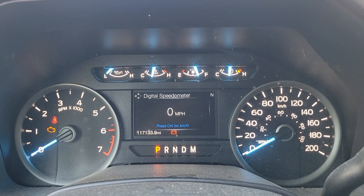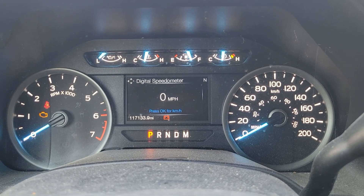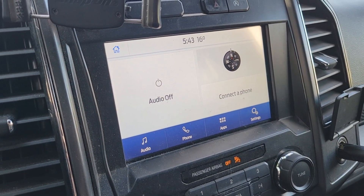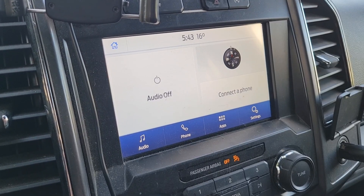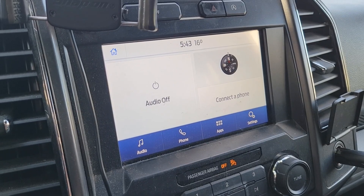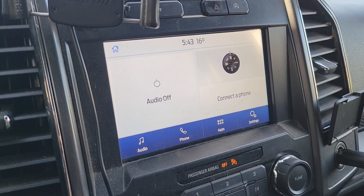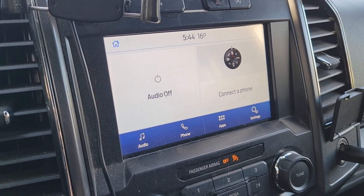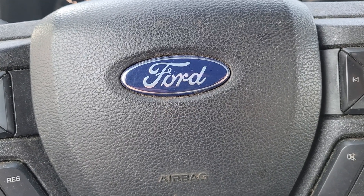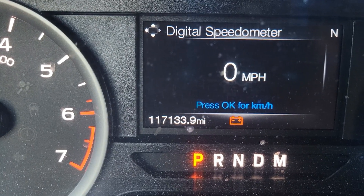The second warning sign — we've all done it. You get home from a long drive, pull in the driveway, shut the engine off, and lean back to listen to the radio for a few minutes. Before, it would stay on for quite a few minutes, but now after even a minute or two it'll shut off to save battery. That's basically a sign the battery capacity just isn't enough, and it's shutting off to make sure your engine is able to start the next time.